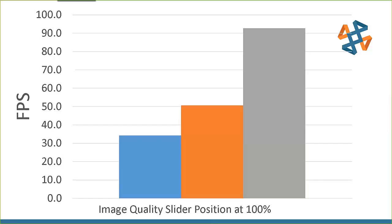With the image quality slider all the way into the red zone as a baseline, the M1000-level card gave around 30 fps, the M2000 gave roughly 50 fps, and the M4000-level card gave 90 fps. A 4000-level card is more expensive, but consider: the M2000 gives 50 fps versus the M4000's 90 fps. You're only 10 hertz away from having an image every monitor refresh cycle on the M2000 — a lot of those extra frames will be discarded anyway.